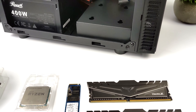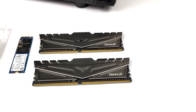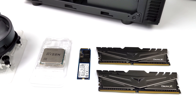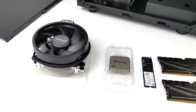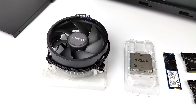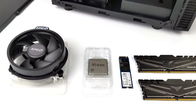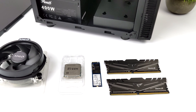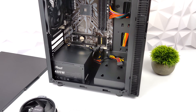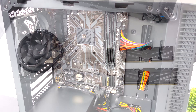This is kind of a no-frills gaming PC. With what we have here we're actually going to be getting some decent performance for PC gaming and emulation. Later on down the road, since we have enough room and a power supply that can support it, we can add a GPU. The CPU we're using here has plenty of power to support something like a 1660 or even a 3050 or 3060, because this setup is going to be powered by the new Ryzen 5 5600G. We've got 6 cores, 12 threads, and integrated Radeon 7 graphics that we can overclock.